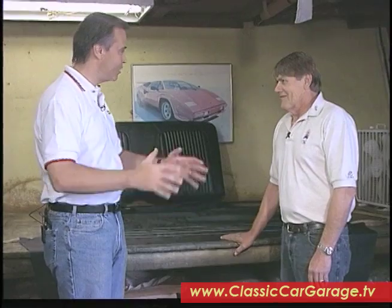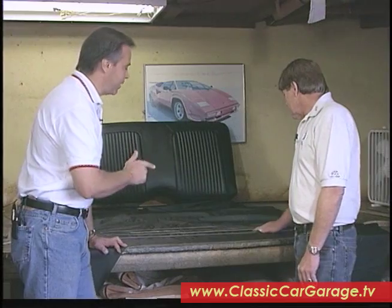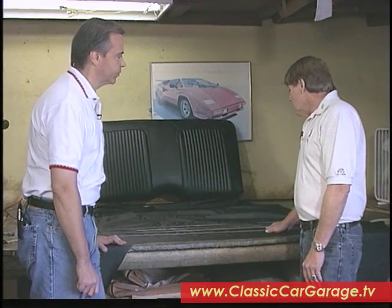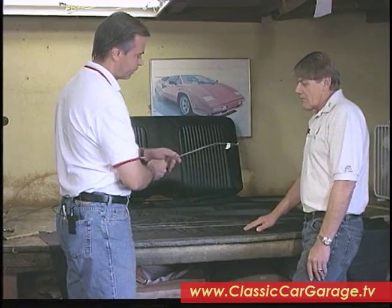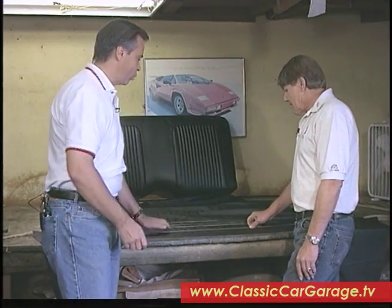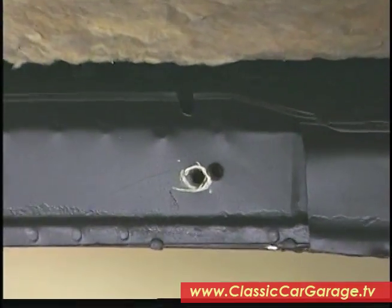In this segment, we're going to tackle a couple of things — one of which is the headliner, the second is the carpet. We'll start with the headliner first, because after all, Jack, if you put in your carpet first, you don't want to be crawling all over that new carpet putting in the headliner. So what we've done is laid our headliner out in the sun to soften it up a little bit. The next step is going to be putting in our top bows. As you're taking the old headlining out of the car, you want to be certain that you number the bows as you take them out, because they are different lengths. I've numbered each of them so I know which ones go in which listing.